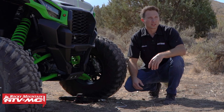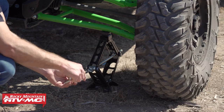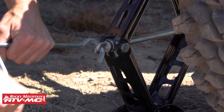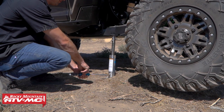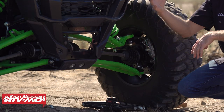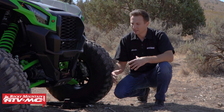Tip number three is to pick a solid lifting point. For most machines with a standard jack, you're going to be lifting on the front wheel out by the end of the A-arm. You can see we have that bend right there — we're going to try to pick a spot more on that level portion. On the rear tire, you're going to lift on that rear trailing arm, or if it has an A-arm, you can do the same thing there. You don't want to lift from the middle of the machine — these side-by-sides have so much travel that you're just going to raise the center and the wheel will stay on the ground. Just make sure you choose a nice solid location so nothing gets damaged.